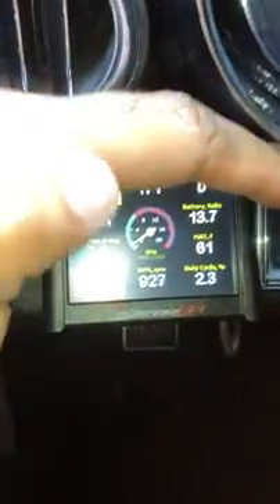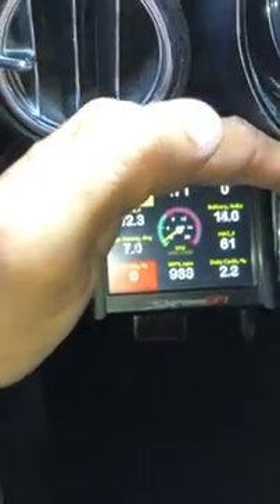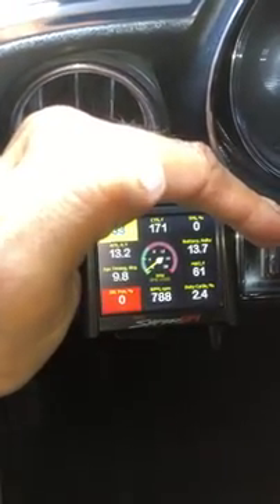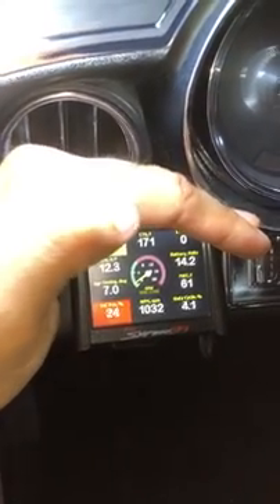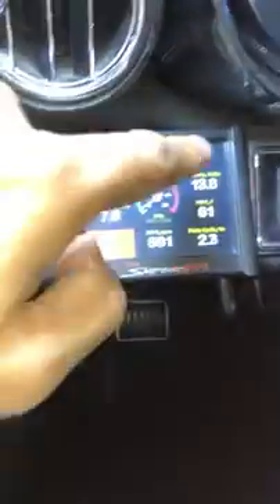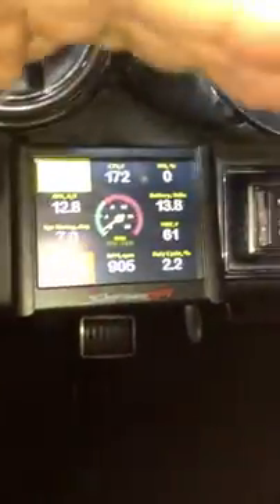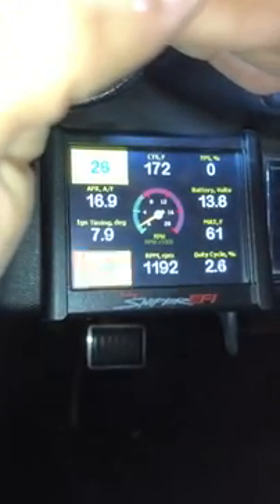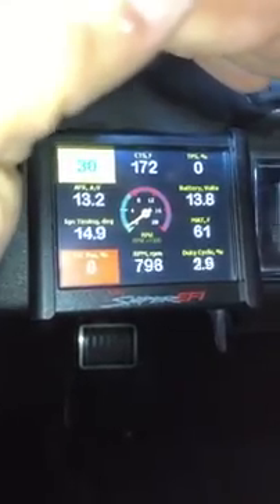You hear that? At every spike, you'll notice my TPS stays zero. For some reason, this ECU is commanding this IAC to just jump out of control — 78% out of nowhere. I've got no accessories on: wipers off, AC off, radio off. I've got nothing going on in here.